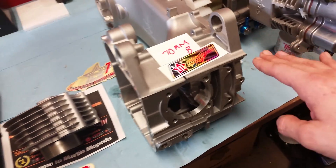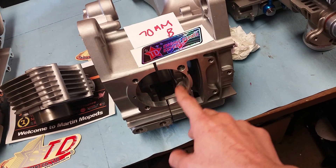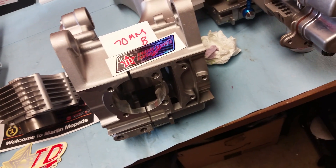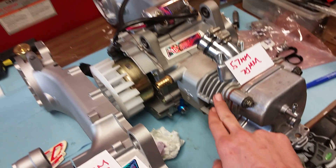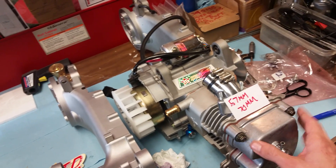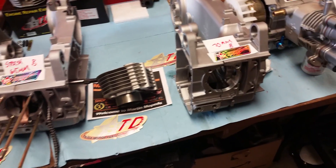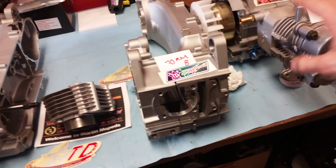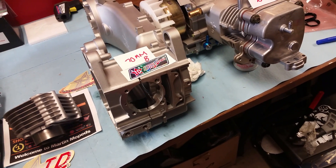I'll be dealing with Tata primarily because look at this quality — this is bored all the way out to 70 millimeters and you still have all this material. It's just phenomenal. They have their own castings, and this one has oil cooling, it's water-cooled, a completely aluminum cylinder, four valve. This has never been fired up yet — I am super stoked about this one. Tata's comes in at 70 millimeters so you can fit any of the B block cylinders you want.